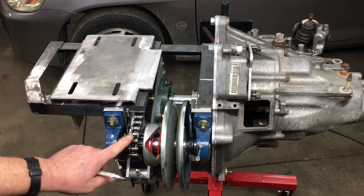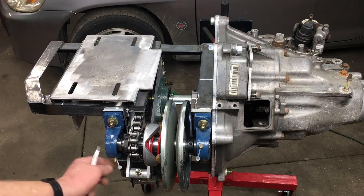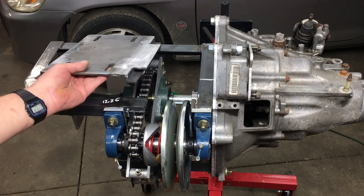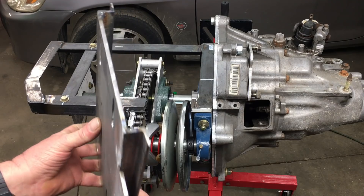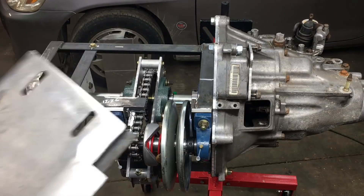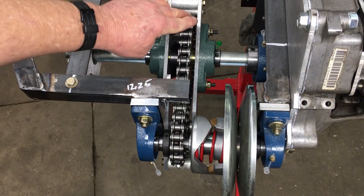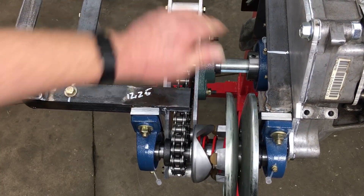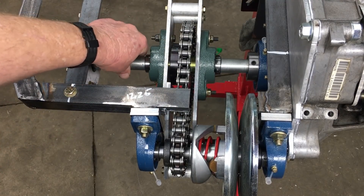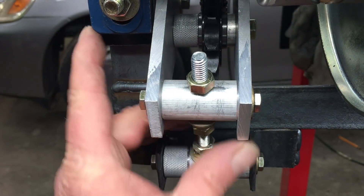Let's take a closer look. Keep in mind I haven't put any keys on the shafts yet so nothing's really locked into place. The motor mount I ended up using is made for a Honda GX390 or a cloned big block engine — I had to modify it quite a bit and designed it to bolt in place. The reason I'm not welding it on is because we'll still be running the smaller 212cc engine as we continue our experimentation. Eventually we'll do the 670cc V-twin, but let's not get ahead of ourselves. Right now I have the chain really tight, which is bad, but it just shows the adjustment system is capable of really cinching up the chain.